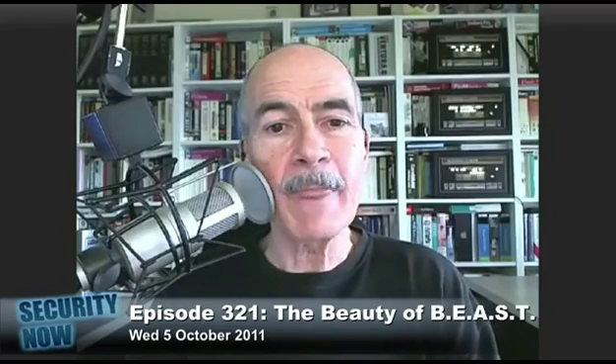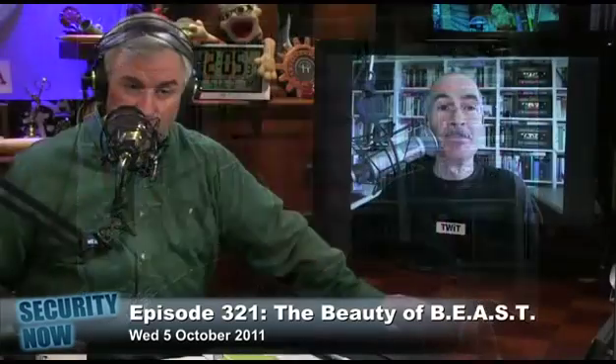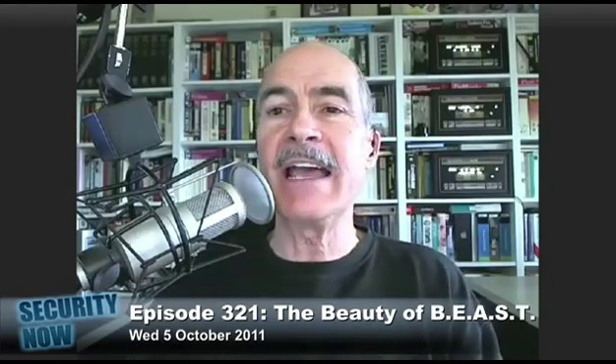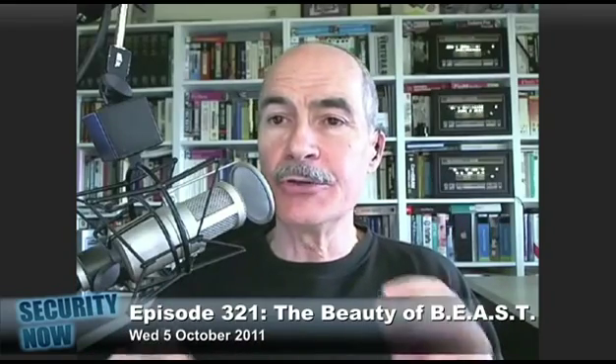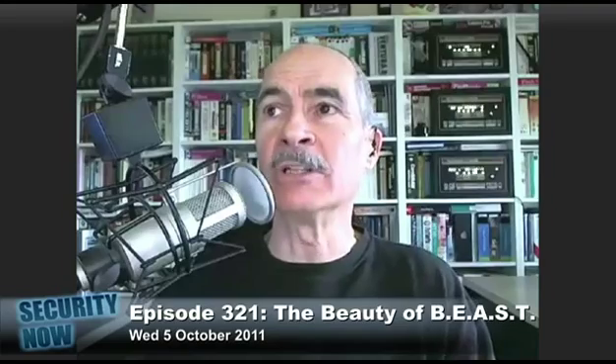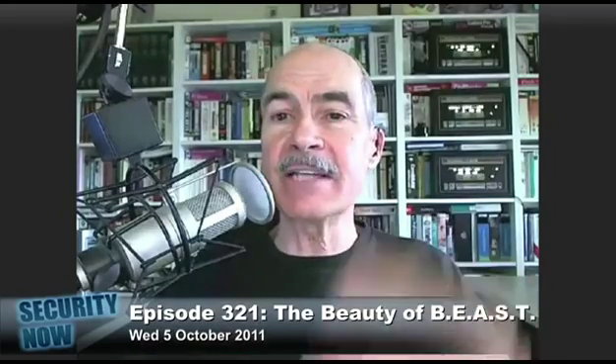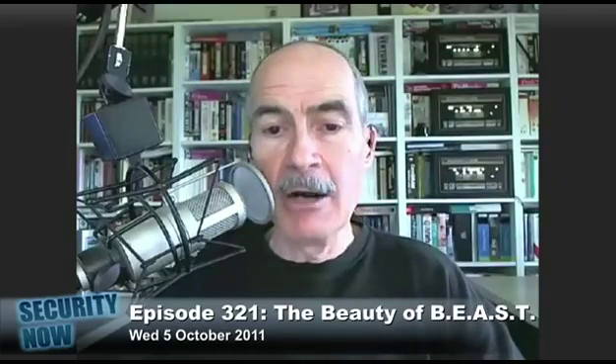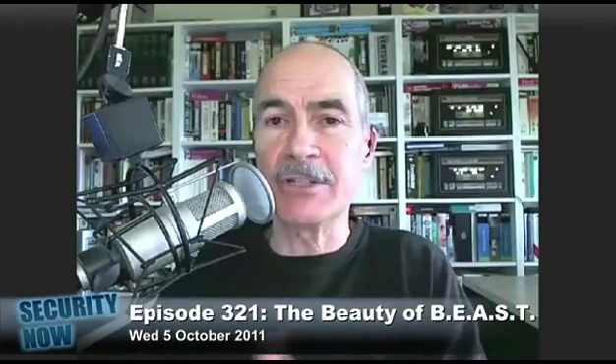Keeping it charged makes it happier. That's really good information. So like your laptop — you should leave your laptop plugged in when it's on the desk. What will happen is sometimes the laptop battery management circuitry, or actually the software, will say we need to do a couple of charge cycles to recalibrate our battery meter. That's an explicit reconditioning process. Normally you leave it plugged in, and the circuitry deliberately stops using AC power, takes the battery all the way down, brings it all the way up, and that allows the metering circuitry to see what the lifetime is in order to properly estimate the percentage of fullness at any given time.